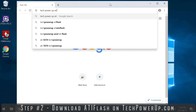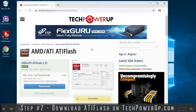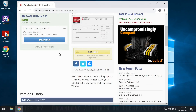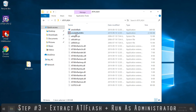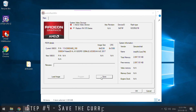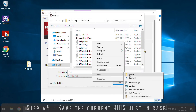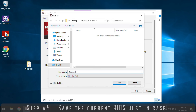Download this. Then go to Google and type in ATI Flash. The first thing that pops up is the download from Tech Power Up. Click on there — it's this program right here. You download it. You have to actually launch it as administrator, so right-click the EXE and run as administrator. This program loads up, and then you want to save — first off, save the original BIOS that's on the card. You know it works with the card somewhat.